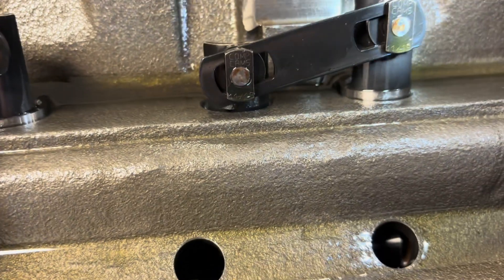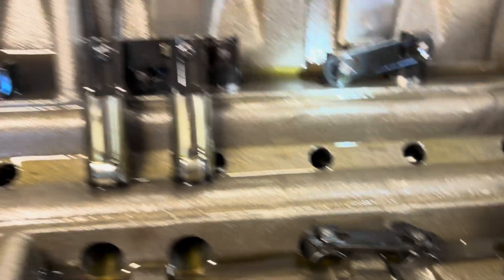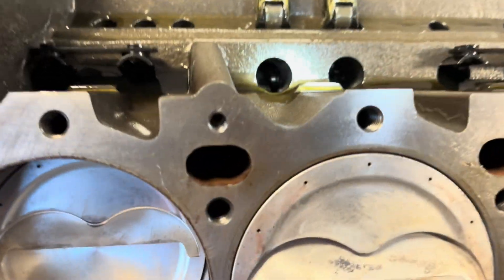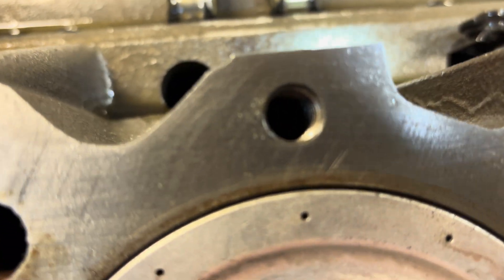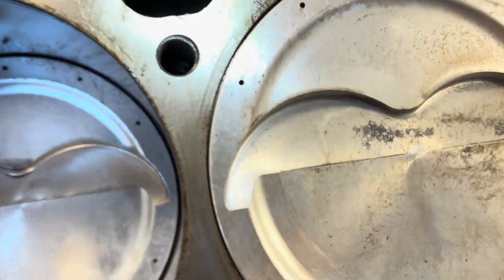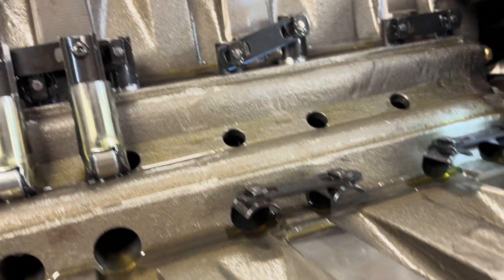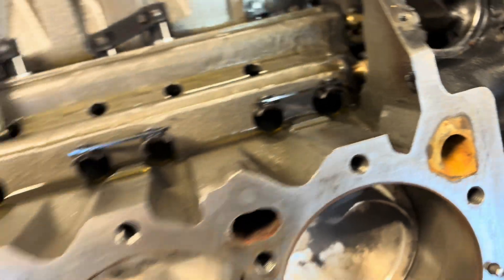Notice these are Comps, and I see a date of 11 — I believe that's 2019. They're good about putting their dates on there. I'm going to pull all of our lifters out as we just keep on tearing in and slowly disassemble this thing to see what else is going on with it. We have really fine holes here to block those off. So there's definitely plenty of oil coming to the top end, and we'll keep pushing forward.